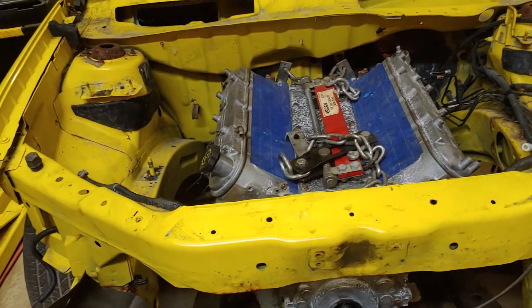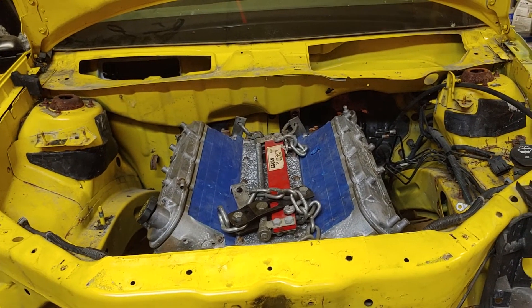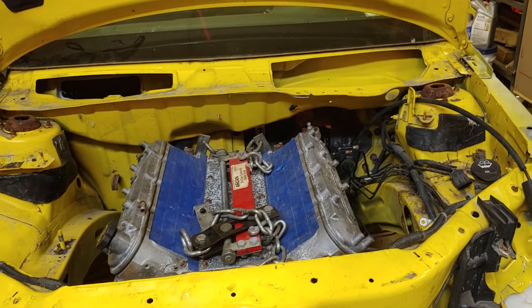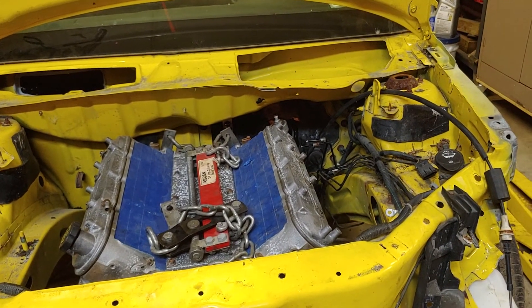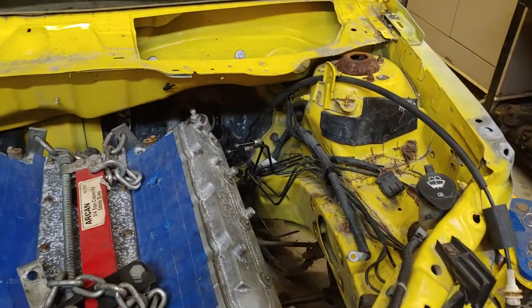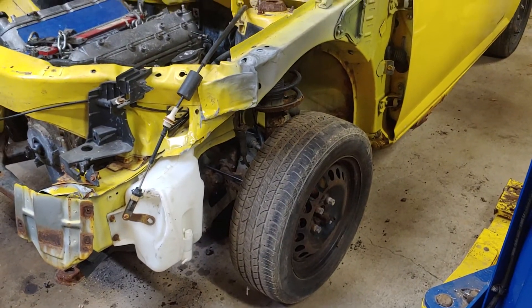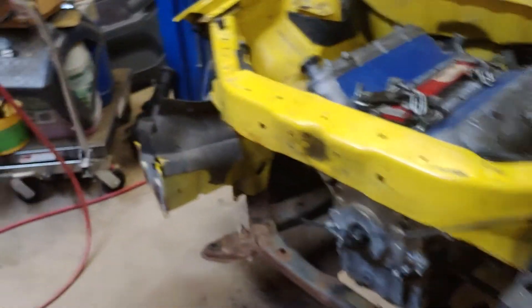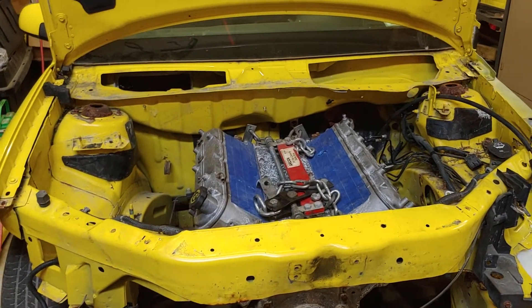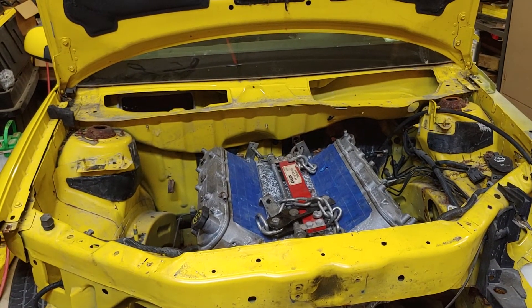Finding a balance for where this engine is going to go is going to be dictated by those CV shafts, because you want them going straight in and out at ride height. I don't want to be going through custom CV shafts every two weeks. Wheel scales — where you put one under each wheel and can see your weight bias — are one of the investments I'm going to have to make soon. I'm going to wind up buying a lot of tools before this is done; there's always something else you need when you want to make a project turn out nice.